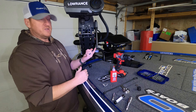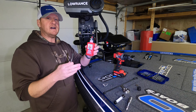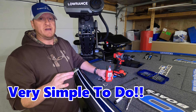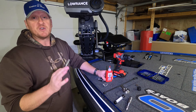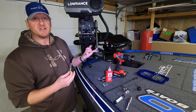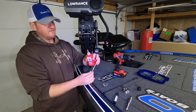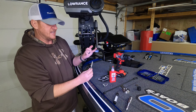You don't have to drill any new holes - the hole that's already there is the perfect size. All you do is take your drill tap and cutting fluid and tap the hole. If you're not sure how to tap a hole, there are plenty of videos out there. I'm no expert - I could count on one hand the times I've done this. If you're not comfortable, you can take it to a shop. Just make sure it's a 3/8-16 drill tap. Apply some cutting fluid and use the drill tap to get the threads inside the stabilizer bar.